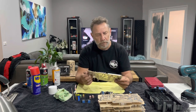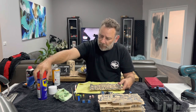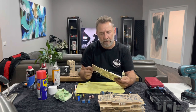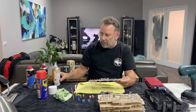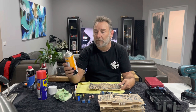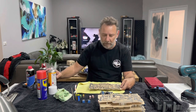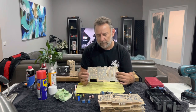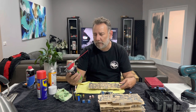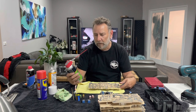So I've done a close up and I'll do a before and after shot. What I've decided to do is hit it with some WD-40, and what that's going to do is just get rid of any of that last little bit of corrosion. Then after that, I cleaned it with isopropyl alcohol, just to make sure there's no residue left from the WD-40.